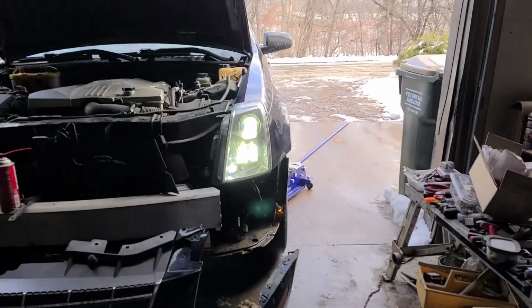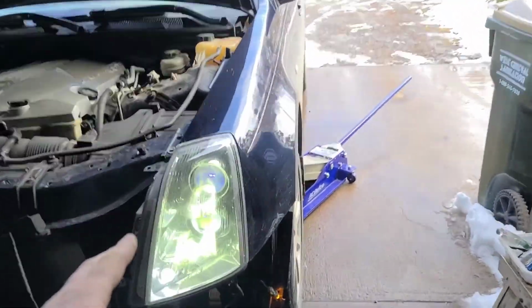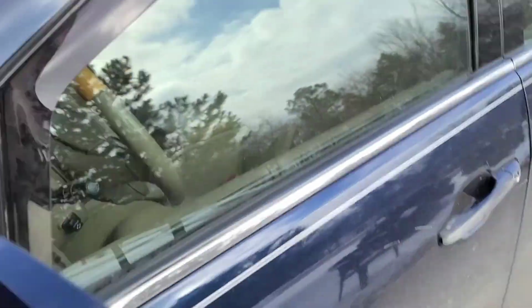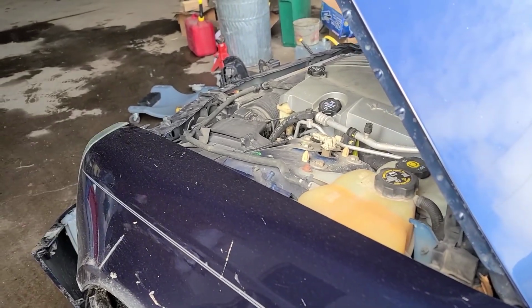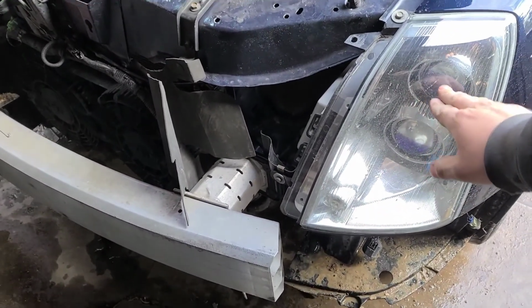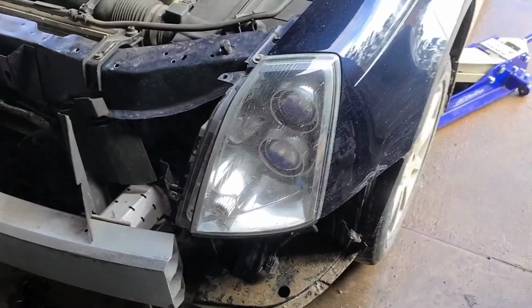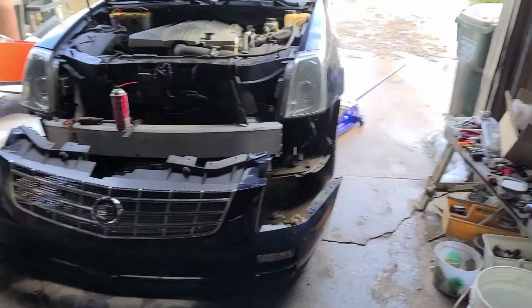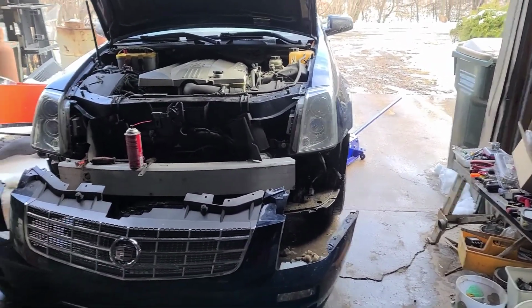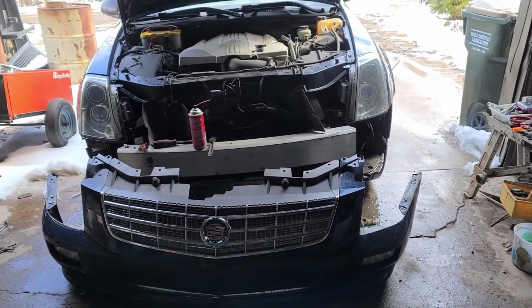It's just dramatic. Now, I understand why people probably want to do HID, the factory ones. This is a pretty cool color from the factory. It's more modern. It goes with a lot more of the modern Cadillacs at the moment. But at least these ones are. When I got in the accident, I replaced the left headlight, the bulb was a different temperature or something, had been used more, I don't know, but it was a different temperature than the passenger side, and more yellow, just your standard yucky 4300 Xenon. Blech. So I changed the ballast on the bulb out from the old headlight assembly, and so they matched again.